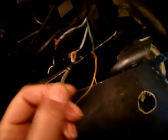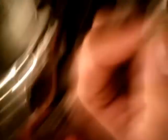These diodes cost about $2 for a pack of 10 on eBay. So when you connect the two diodes at the bottom, what I have here is the two wires, then this is the diode — it's hard to see but there's a little box on there — and the two diodes are going to the positive wire of the light. So this is staying on, and then when I signal it's signaling, and then when I turn it off it stays on. And the rest of the bike is just normal — no lights staying on in the front, no lights staying on in the back. It's just a regular red light.